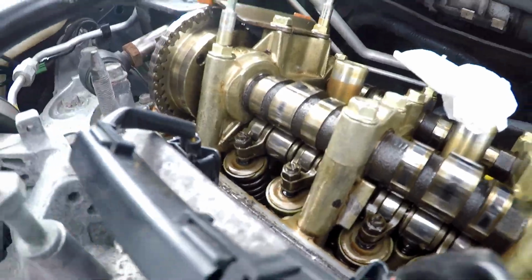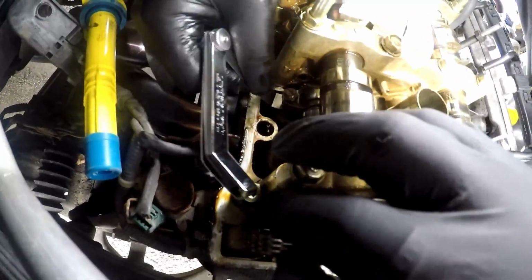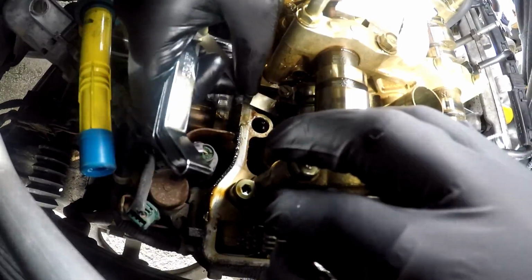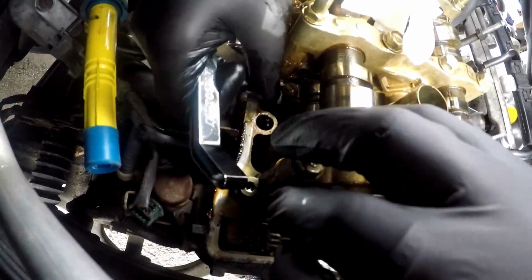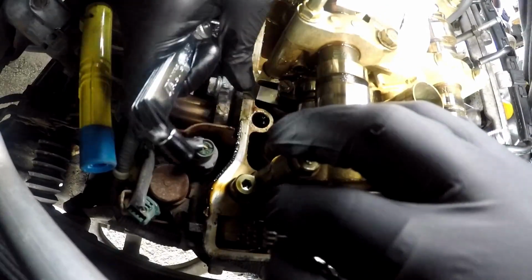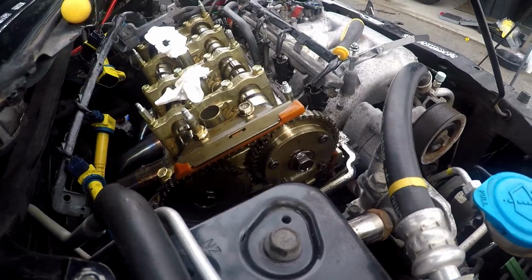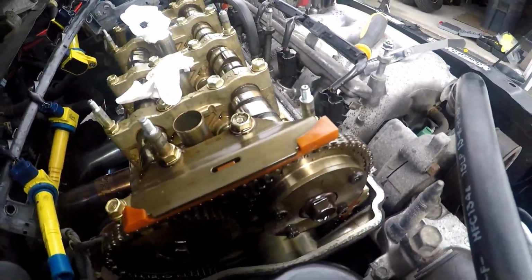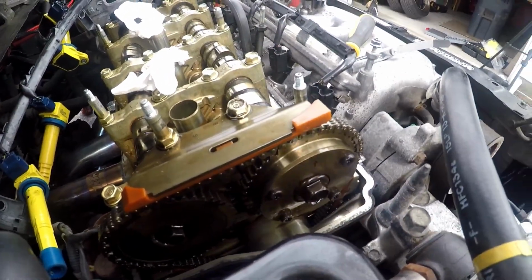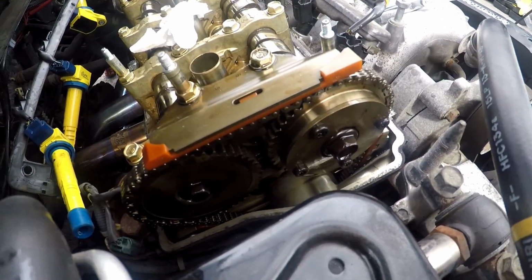Oh, okay, perfect. So now I got to get the exhaust side, which is going to be 10. It's going in and it has a nice slide. Yeah, that's perfect right there. That feels great. Now to get to cylinder 2, top dead center, we're going to turn 90 degrees. So I'm going to take this, I'm going to slowly turn it 90 degrees clockwise.